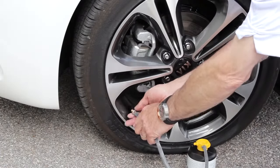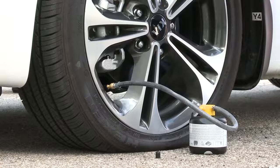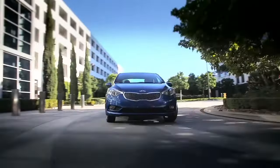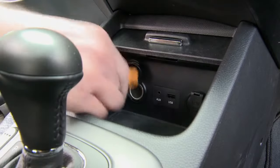If you can see the nail or screw that has caused the puncture, do not remove it. First, twist the cap off the stem of the deflated tire. The first connection is the inflator hose to the canister, and the hose from the canister to the stem. On kits where the pressure gauge is attached to the inflator hose, make sure the screw cap is tightened — this is used to reduce tire pressure and needs to be closed at this point.